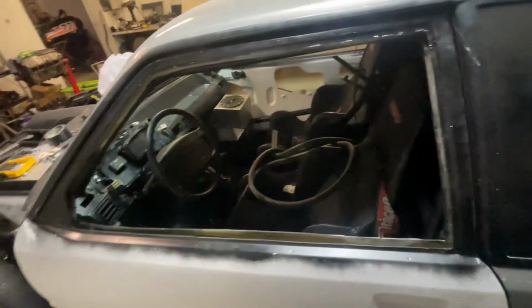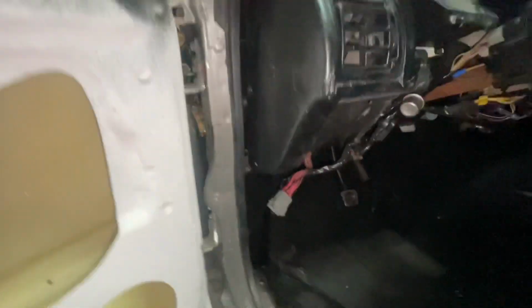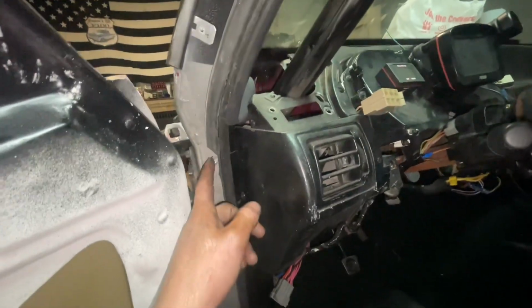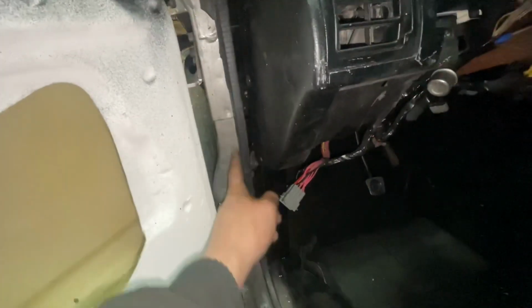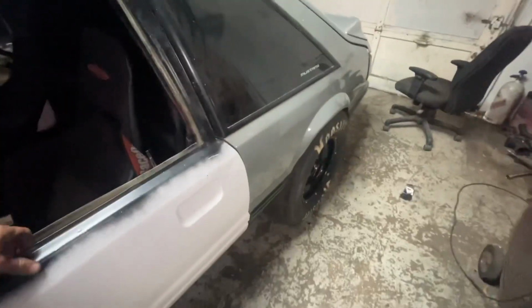I'm gonna show y'all a trick with the seal for these light doors. So what you do is you come in here and you slit this. What I do, I cut it right here because this is the first point that closes. So I cut it here. I skim it all the way down the bottom of the door and come back up. And the reason why we do this is because these seals are used to a 100-pound door. And that's usually the first thing that touches up front that makes these doors where they don't shut.